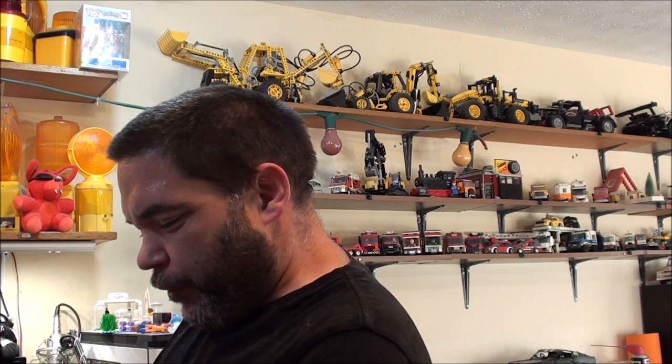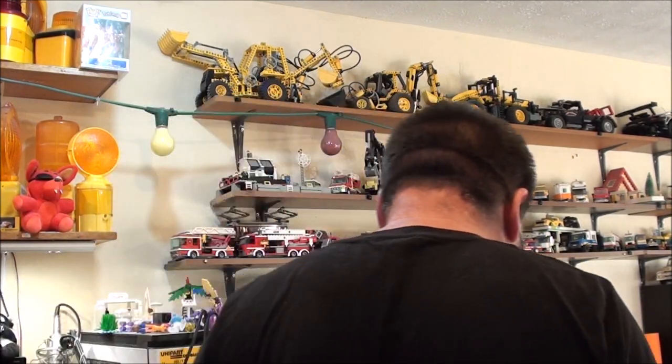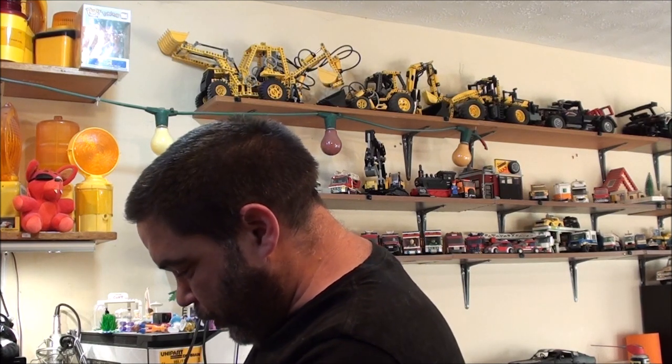I've done it on a Transit Connect van before — in fact it was the van previous to the Mercedes Vito he's got now. Some dipstick ran into the back of him when he was up Norwich one day, and it got written off. Otherwise I'd bet he'd still be using that van. On that Transit Connect it was piss-easy, took me about 20 minutes. Being front-wheel drive, all I had to do was stick my head under the front bumper — didn't even have to jack it up. The starter motor was right at the front at the bottom, two bolts, two wire nuts, take it off, slide the new one in. I think I can understand why mechanics charge what they do now, because some of these vehicles are an absolute pain in the arse.